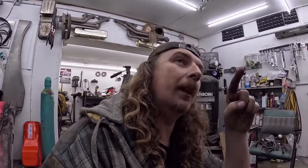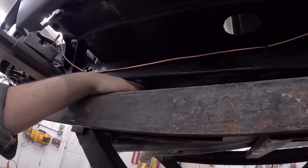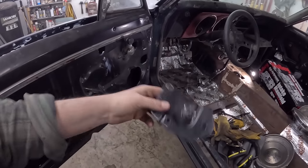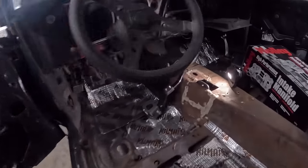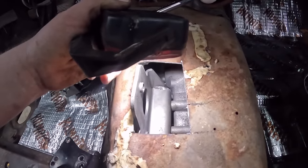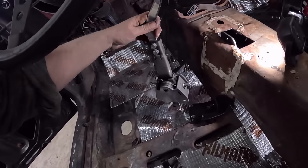The other thing I remember from my Nova — I think I have to trim the clutch fork. I think it might hit the floor. That would have been way easier to do with it all apart, but hey, we'll struggle. I'll get this piece on and show you. It's going to be under the car and I'm going to be bound up like nobody knows trying to get in there, so it's going to be terrible. Well, the old measure zero times and cut once burned me. So this was the plate that was on it — it basically was straight up and I had to cut a bit of a hole because it sticks up. This one kind of really jogs over towards the driver side. It jogs over but then the shifter brings it all the way back, but such is life.